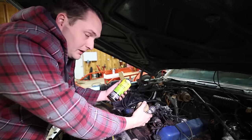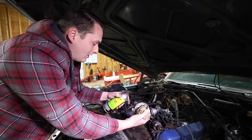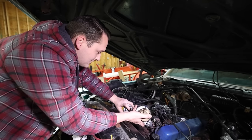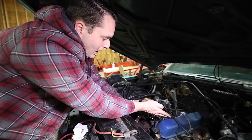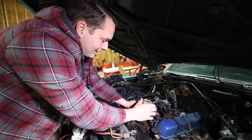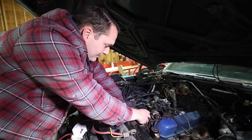I broke it. Well, to keep this from happening again, I'm gonna use some Rogo high temp anti-seize and just spray it on all the bushing surfaces, basically. The last thing I wanna do is be breaking distributors out of here another time. And we'll slide this thing in. I had it pointing pretty much opposite of the valve cover in this direction towards me. So I'm gonna line it up just a little bit ahead and see if it slides right back into place.